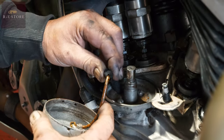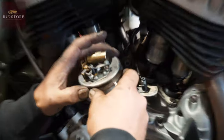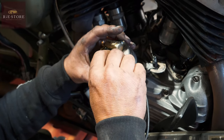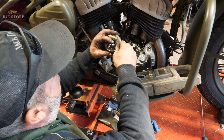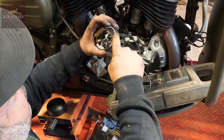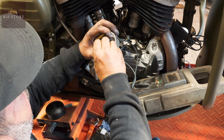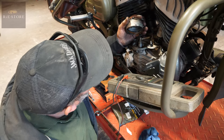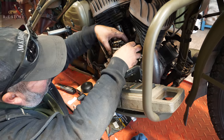Plenty of length on that. That's your usual bodge outlet. I haven't had it apart. That's nice and tight. Ideally it needs a new one of these — you'll have tape wrapped around it in the nut, that shouldn't be on there. In theory, that's working, because that's connected to that. When your points are shut, your power is into there. I think that will be okay, but ideally you want a new wire on it and a new distributor base because this isn't right. But it's not loose and it's not losing contact through there.